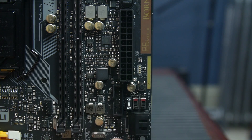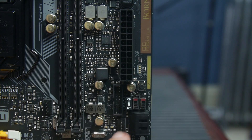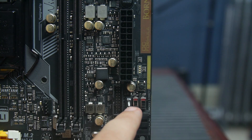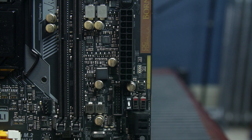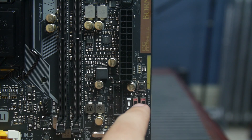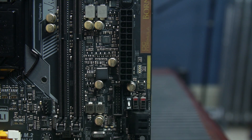There are physical switches on the board for things like toggling liquid nitrogen mode and putting the CPU in slow mode — running it at its slowest supported configuration, useful when troubleshooting an overclock. One switch toggles XMP mode on and off, so you can activate your memory's extreme memory profile without entering the UEFI. There's also a front panel USB 3 header for ports from the Z170 chipset that aren't available at the rear.